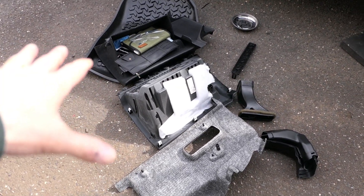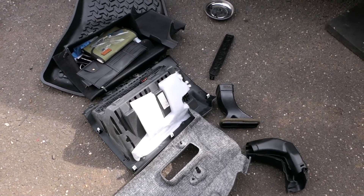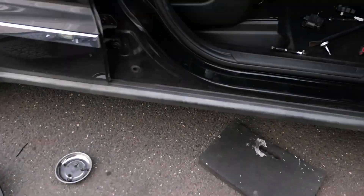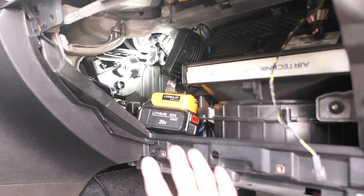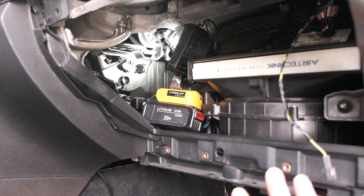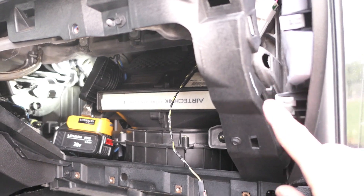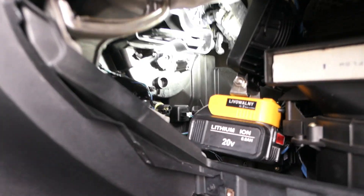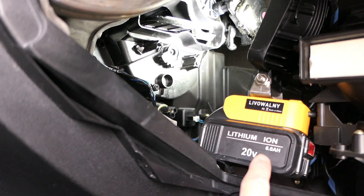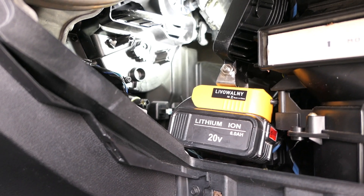This has all been apart — there are many videos about how to take this apart. I'm on the passenger side; the driver's side is a little different. On the passenger side you have the glove box, and all this has to come out. It's not that difficult — basically there's a bunch of screws, this panel has to get pried out, and that's enough access. There's also a plastic duct piece that comes off here and down, which I took off later for a reason.